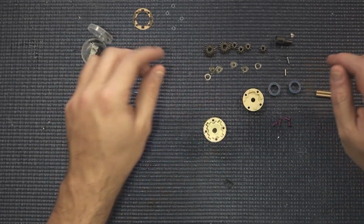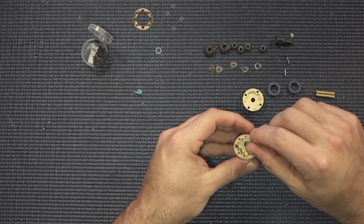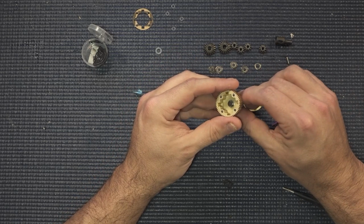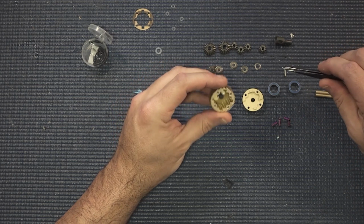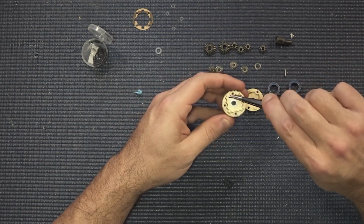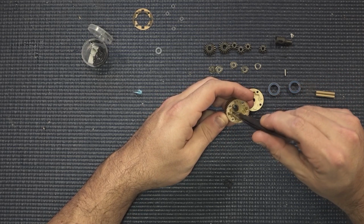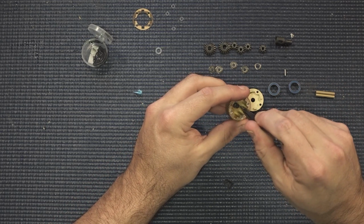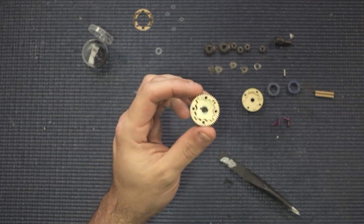And then, of course, we're going to take one of these larger washers and put that inside there. And you might need some tweezers. Things like that would help out. All right, we've got that down inside there. It's going to make our life a lot easier. Now what we need to do is take one of these out drive pins here, and if you look inside of your gear diff, there's actually lips there, but there's no lip right here. So we'll actually be able to slide that down in there, and then you're going to rotate the actual out drive so you can get that pin through the hole like so. And then it's all going to be held in place inside there. Real simple, real easy. All right, now that is step one complete.